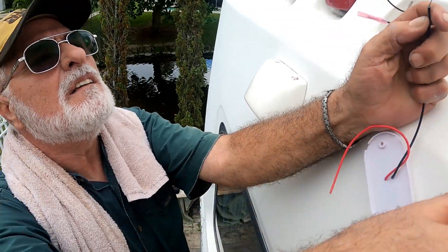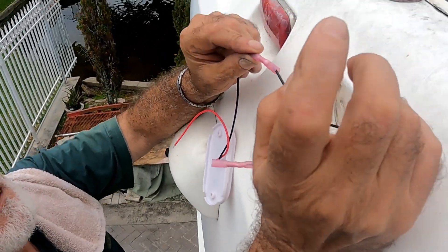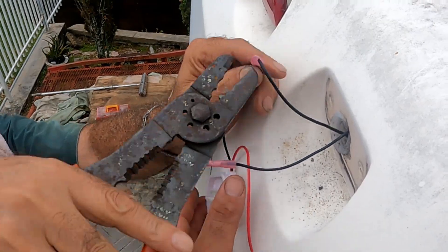We do the same to the new light wires. By having different color wires it's very hard to figure out the polarity, and LEDs are very sensitive to that. So before crimping we check to make sure they light up first, then we crimp.